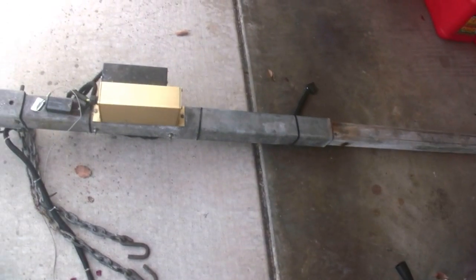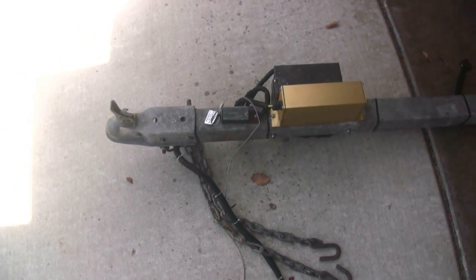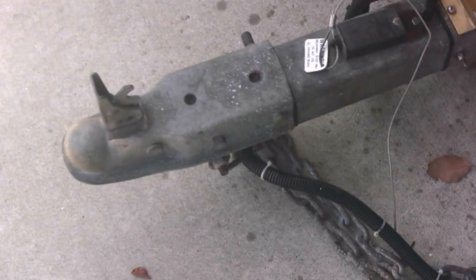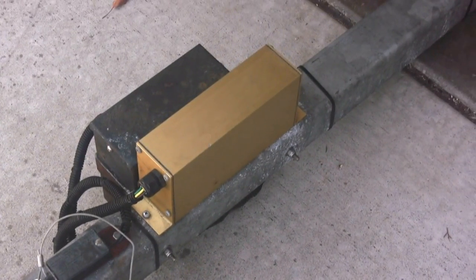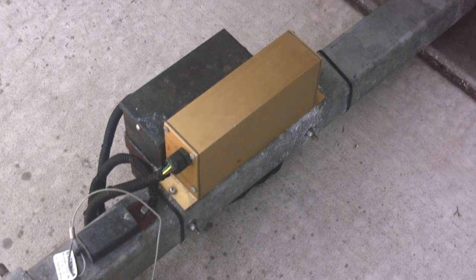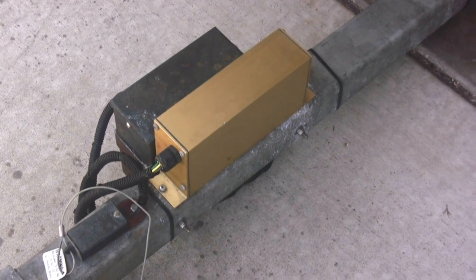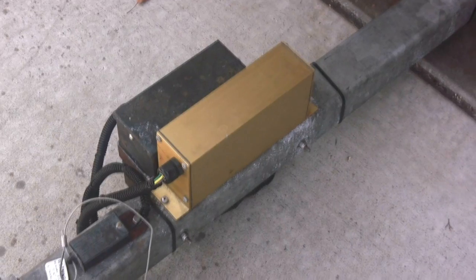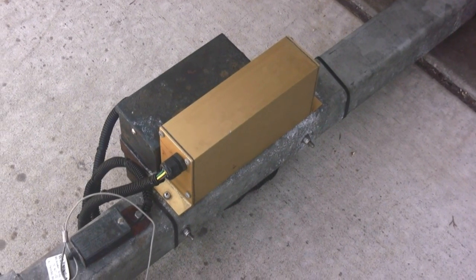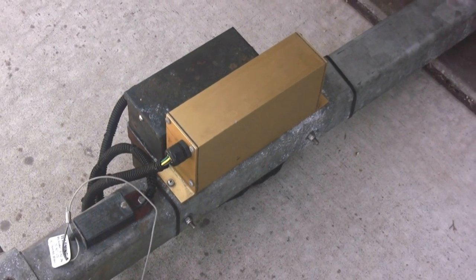This is actually the removable part of the tongue — it's a pretty substantial piece of metal. The tongue in front of the first pin is actually about 42 inches long. It's got a standard 2-inch ball coupler, safety chains, and then the controller unit and the backup battery for my electric braking system. This is a Carlisle electric brake — I think they call it the ElectraStar. Stopping power is not quite what I would have liked, but it's adequate. The main purpose for brakes on a trailer this size is to slow it down should it actually get detached from the vehicle. It's mainly there for safety purposes.